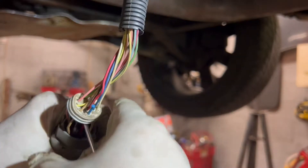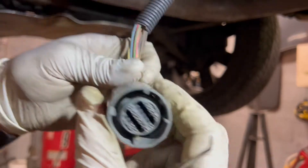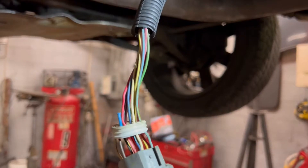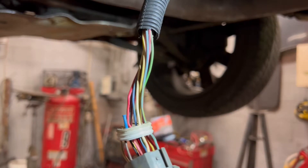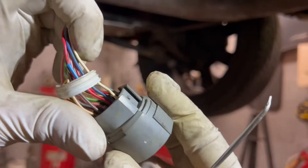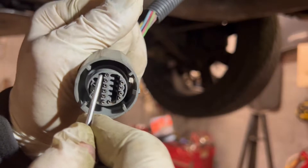It's a good time to take a peek while you're in here - make sure there's no corrosion, make sure nothing's split, make sure everything is seated. The next thing, like I said, you're taking the white wire out and getting rid of it. Take the white wire out first, because once it's out it's out of the way. White's right here - you have to go way down in here.